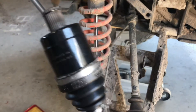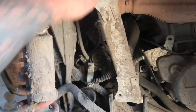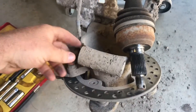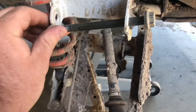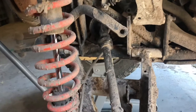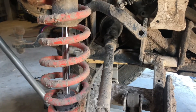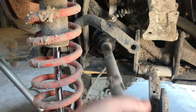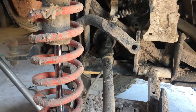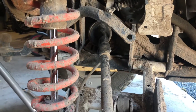So I'm about to replace this axle — this is the first job I had to get back into when I came home. This is pretty straightforward on the General. You basically just undo the upper control arm, undo the CV from inside the center of the bearing, and undo the sway bar on both sides so you can kick it up out of the way. The only issue I have is I broke the thing on that end, so I've got to try and get that out. Normally you just keep these centered and straight and one hard pull and they'll pop out, but mine's broken up in there and this is going to be pretty hard to get out.